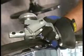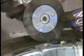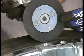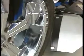An additional bead breaking method is available that will roll the outside bead off the rim. This minimizes the chance of accidentally damaging the outer face of the rim with the bead breaker. Break the inside bead in the normal manner as shown earlier, then mount the assembly on the turntable. Install the demounting disc tool.